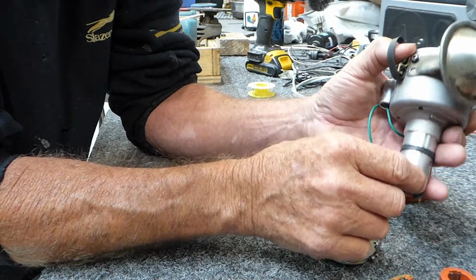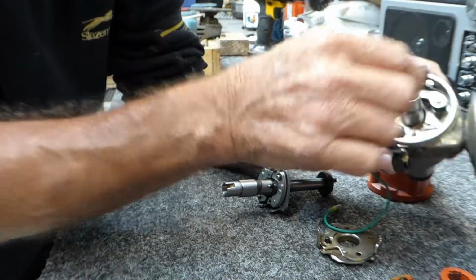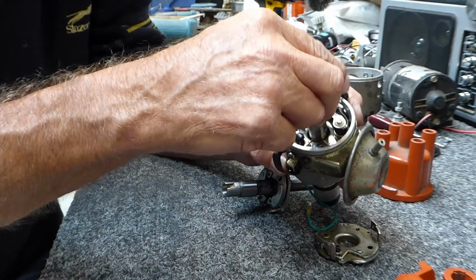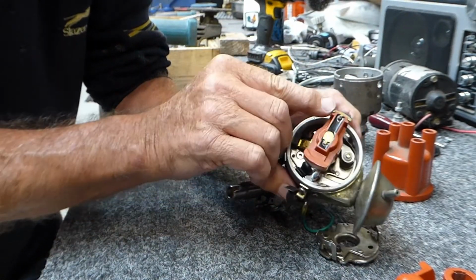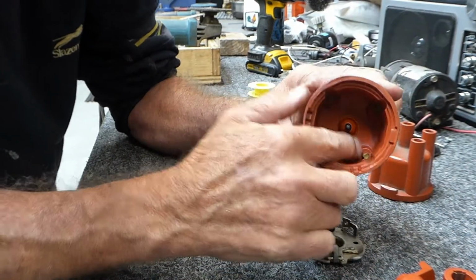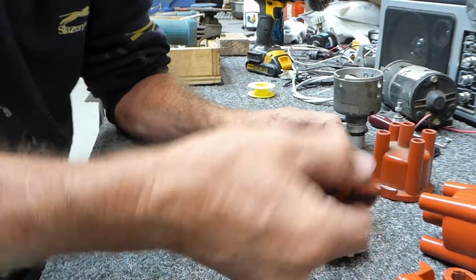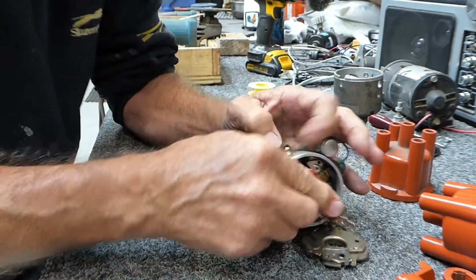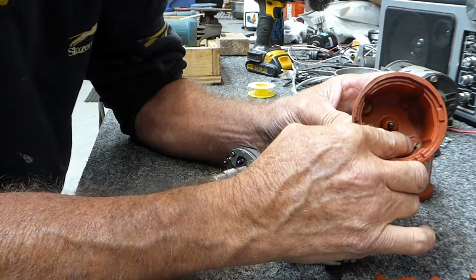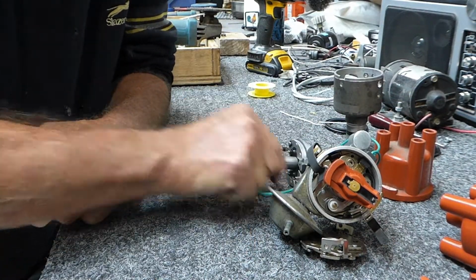So when you do that, you actually end up pushing that further down into your distributor. When you push that further down into the distributor, that's where I have problems with that climbing away from the points. It's basically climbing down off the end of these points because you've dropped it out a bit further. And that's why now I have to put a shim in there to get that in the middle of the contact, not on the very tip, but down the contact at least 2 or 3 mils. Whether that has helped you, I do not know.